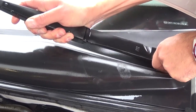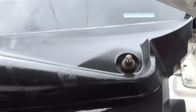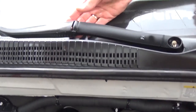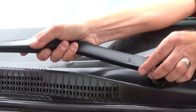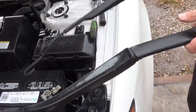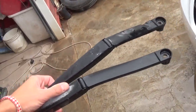If you grab it you need to wiggle it a little bit back and forth and it will come out — it goes in on teeth here. On the Sonata they're inconvenient because they're very long and halfway under the hood. So that's how you remove the wiper blades and arms.